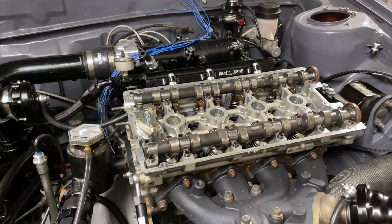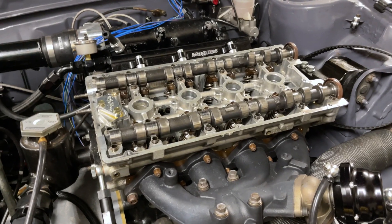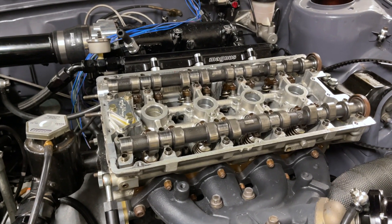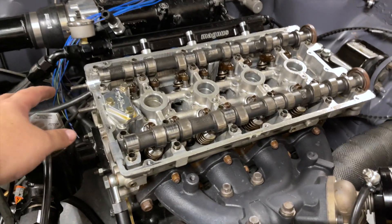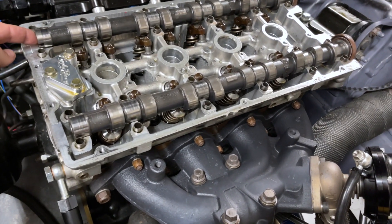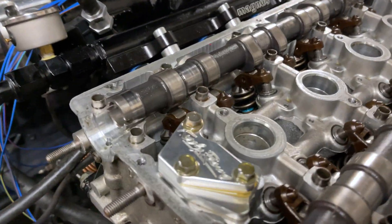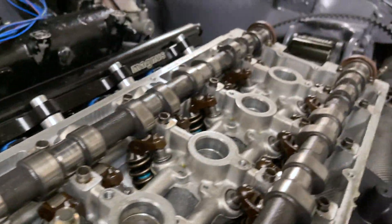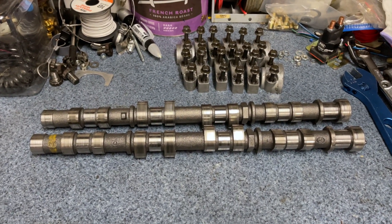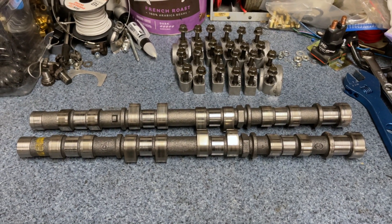I realize we're in the middle of an ECU upgrade right now, but I've also had these cams that I've wanted to upgrade for a while. It's become necessary to upgrade the cams with the new ECU upgrade — I'm going to a 2G Evo-style cam angle sensor and housing, and the cam needs to be drilled on the end for the sensor trigger to bolt onto. These HKS 264s are not drilled there, so we're going to put these Kelford 272s in and finally get that upgrade done as a necessary update to be able to use the new cam angle sensor for the new ECU.